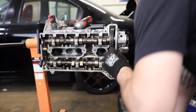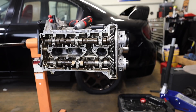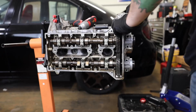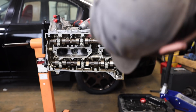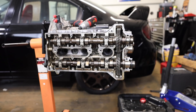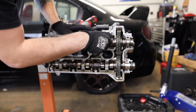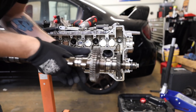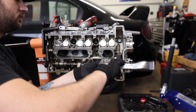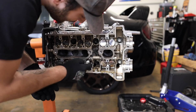I'm only going to film taking off one of these heads after we get this head off. I'm going to do a live stream on the other head. We're working on getting this thing off — it's still on there pretty tight. Make sure if you're doing it this way you're not going to hit the cam on the backside. Last thing you want to do is demolish your cam gear. Next thing we're going to do is just pull out the cam — it should rotate and loop right out. We need to break these six bolts loose equally, so I'm not going to use an impact for this. We're going to use a standard hand tool. There's our cylinder head — these buckets just want to ploop right out.